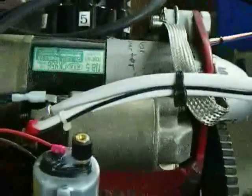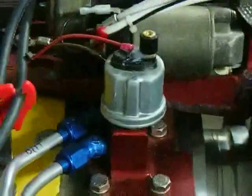There's a ground wire there so you get a good solid ground for the starter, because there wasn't one. Some of the sensors for the oil pressure and oil temperature — you can't see the temperature, it's kind of hidden in there. I've got hard lines coming out of that block down to a block here where they go to the flexible lines, which go down over to the oil filter. The oil cooler lines come off there — I haven't finished those yet. Got the standard exhaust logs on here with the EGT probes — there's six of them total.